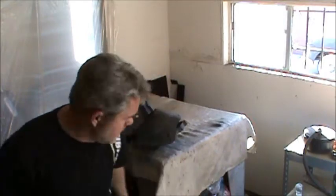You've heard me talk about this before. Reason being is that if you don't have some place for the weld to go into, then if you weld it on top, it may not permeate through the metal all that well, and when you grind the weld off the top, then you'll still have the stress crack hiding underneath, so to speak. So you just cut a little groove in there, weld it up, and then sand it.